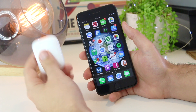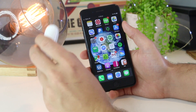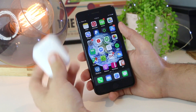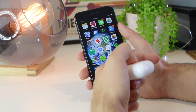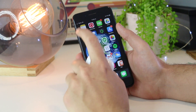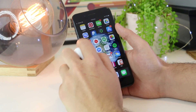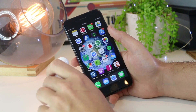Another step that I've come across — and this is especially helpful for those using AirPods across multiple devices — is to turn the Bluetooth off on the other device you may be using. In my case, I go between my MacBook and my iPhone with my AirPods. Sometimes when I connect the AirPods to the iPhone, there's still a false connection between my AirPods and my MacBook Pro. Simply disconnect the AirPods or turn Bluetooth off on your MacBook, Apple Watch, or iPad, then reconnect your AirPods to your iPhone. You can also reset the AirPods as well, and this should resolve any issues you may be having.